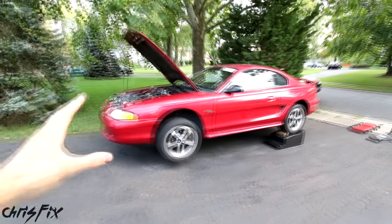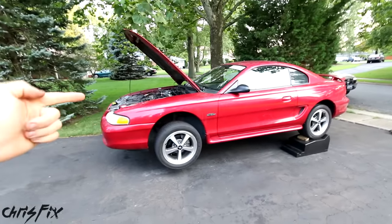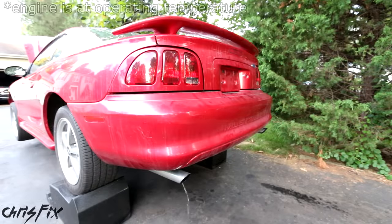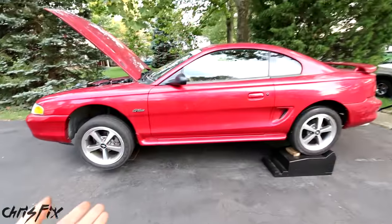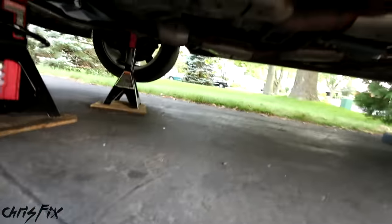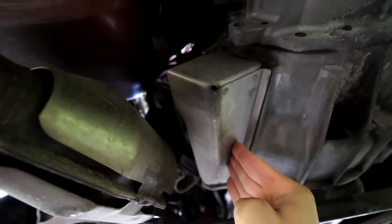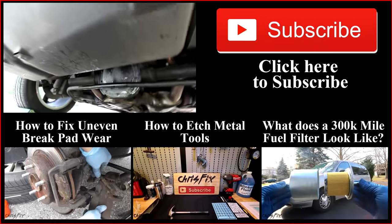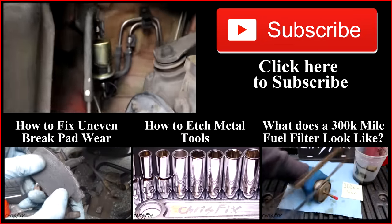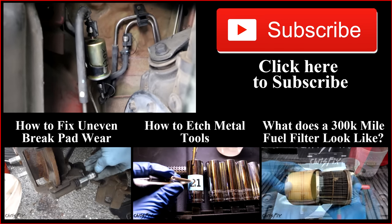Project Crowd Control is now alive — we are going to do some awesome stuff to this car. Hopefully this video is helpful; if it was, remember to give it a thumbs up, and if you're not subscribed, consider subscribing. How did that sound? That sounded awesome — but you hear this? That doesn't sound good. Looking underneath the car, it's just this heat shield that's making noise — got me a little nervous, I thought it was the engine, but we are good. Another thing you want to do right away is make sure there's no fuel leaks anywhere, since we disconnected those quick disconnects — you don't want to see any dripping fuel. Also check when you go fill up the tank. But this all looks good.